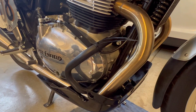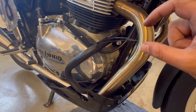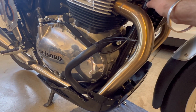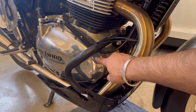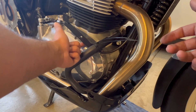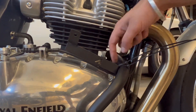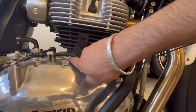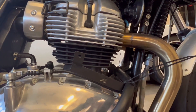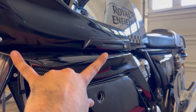Something that can be neglected while installing this kit is your clutch cable. Because we moved the clamp down from the factory location, it actually forced the clutch cable to bend and touch the engine. With the engine heat, the clutch cable boot is going to get eaten up. Using the magic of zip ties, I now have about a finger's width of clearance between the engine case and the clutch cable, so I don't have to worry about the heat.